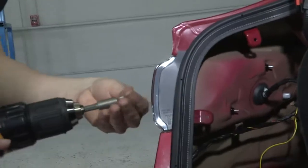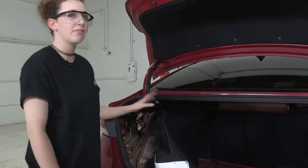Next we're going to attach our ground wire, which is this white wire here. We're going to use a self-tapping screw and our electric drill to connect it — nice and low down here so that the box has a nice place to sit behind this trim panel. Make sure that's nice and tight so you don't have a loose ground, which can lead to some electrical problems. For the power wire, we have a few options — there's a plug in the body and a vent — but the best way is to use that plug right there where we've already got wires running through, away from the exhaust and anything hot.